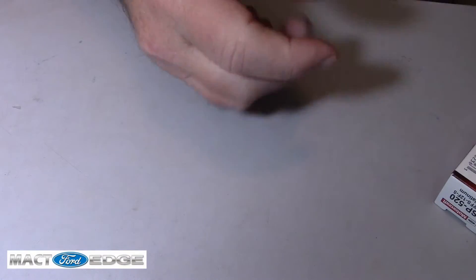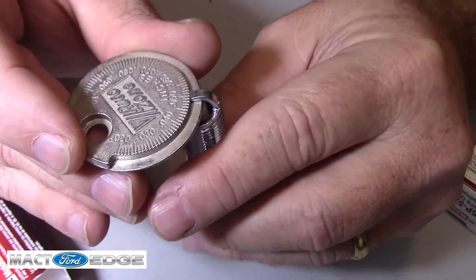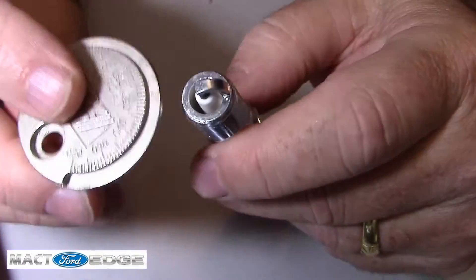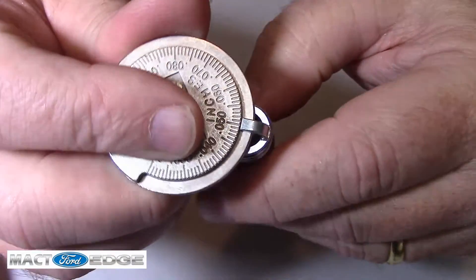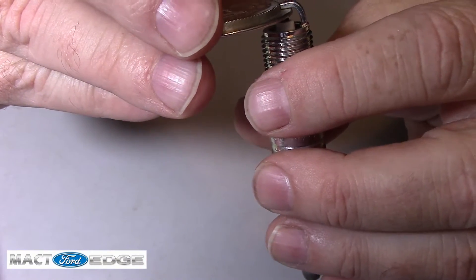That was a little tight but it was going up that far. Spark plug number four — let's slide it up here and see where it goes. It looks like we got a .052, .051 again. Be careful — you don't want to twist them and make these gaps any bigger. Do it real carefully and gently and you shouldn't have any problems. Plug five — slide this one up here and we're at .051 again. And plug number six — .051 is what we're at roughly, almost .052.